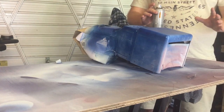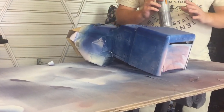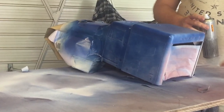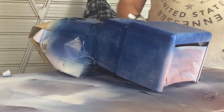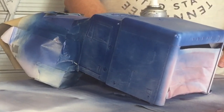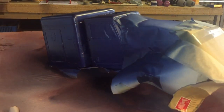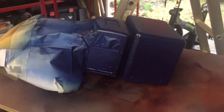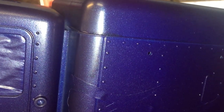I'm going to leave it there for now. The most important thing with the top coat is to really take my time, because if it runs at this point I can fix it, but if it runs over the masking it'll be a nightmare to remove without ruining it. Slow and steady. I've just finished the can and do need to get another one, which is a little annoying as it probably only needs one more coat. Everything's gone fine apart from a slight overspray and a small drip — you can't see it too much, but it'll irritate me so I'll sand that down.